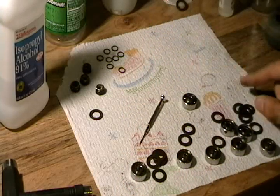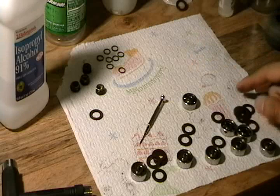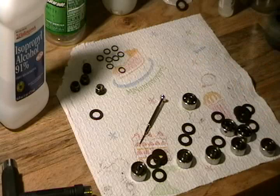But if you have double-sided shielded bearings, that's really good, because you can start taking the shields off the back of the bearings and using them for the front shields when the other ones get destroyed. Or you can always use a shield from an old bearing that's still intact. So any inward bent shields, they're out. Throw them away.